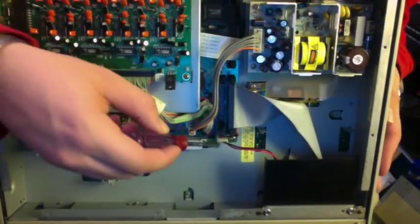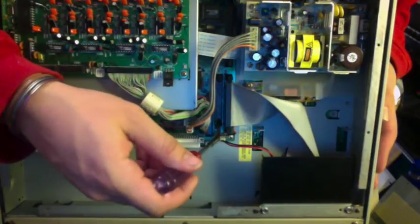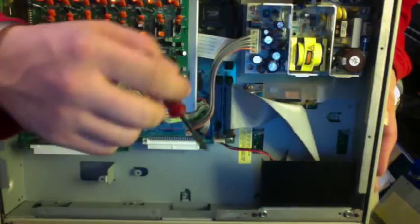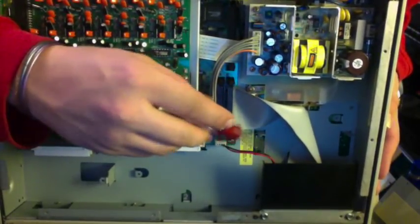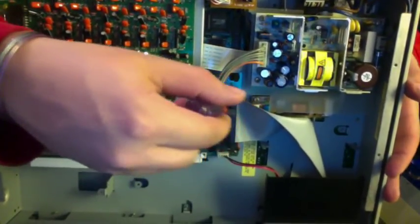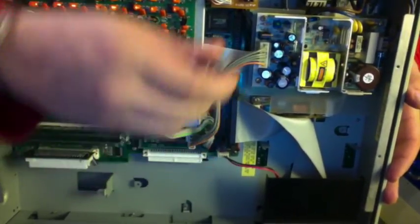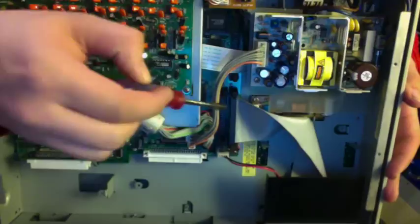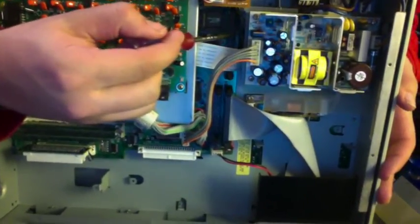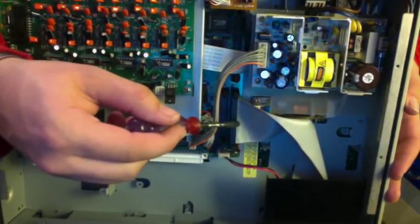Alright, you see what we've got going on here? This power cable right here, right next to where our floppy drive was plugged in, goes straight into the card reader. You might have to make that modification, but this one works perfectly. Over here, your IDE is going to go straight into your last port on the left — right here. It's going to see ATAPI right next to it; it's the port next to the floppy drive. The SCSI port is here, and some tutorials tell you to plug in there, but that's for an SCSI drive — today we're working with ATAPI, so it goes right here.